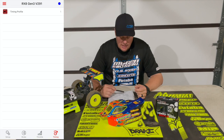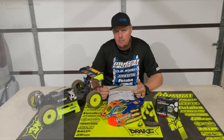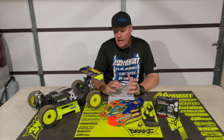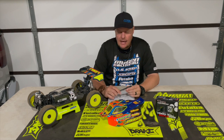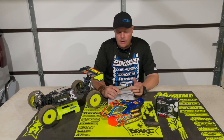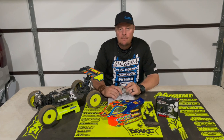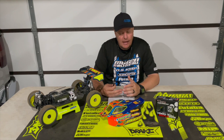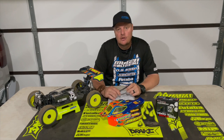The final page is the timing profile, and I just have profile one set at five degrees, which is the minimum. Trying to have settings where you have good, manageable power that is smooth and drivable. It's really easy to overpower your stuff in electric. With the Tekin RX-8 Gen3, there are so many settings you can work on to smooth out and manage the power, both on the throttle side and the brake side. If you're more into bashing than racing, you can bump these numbers up and have ridiculous power. But for racing, you want to make sure you have really smooth, manageable power to get the best results.